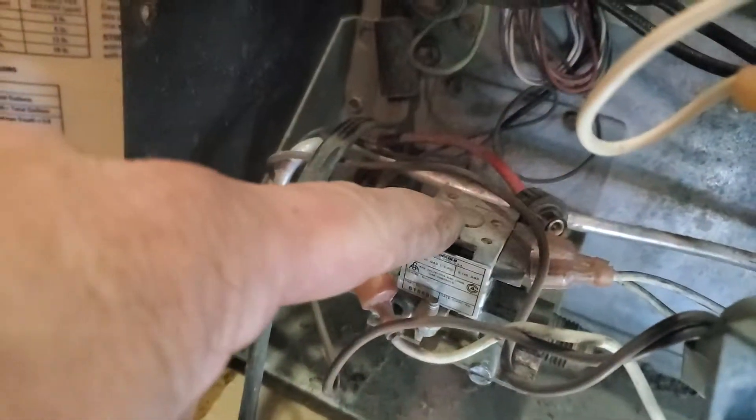All right, here's your igniter. They've got to be an eighth inch away to spark, so that'll set to the side. Now the gas valve is right here. We explained that in the prior video. We're going to take that off — there's a Phillips screw in there. Let me get a good picture of it for you. Right there, there she is.